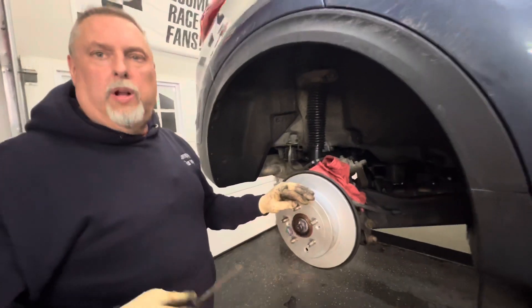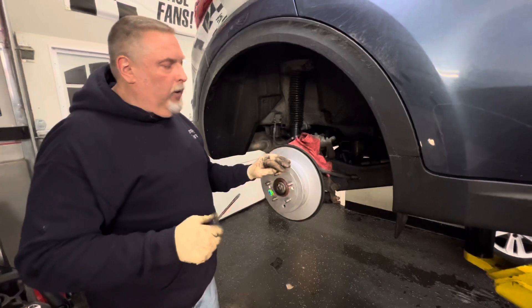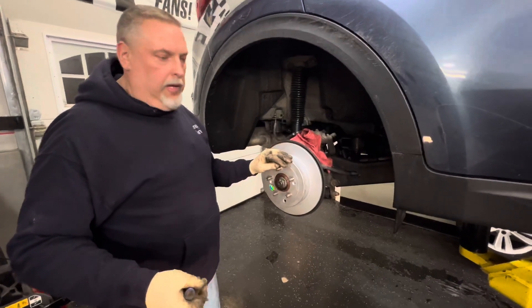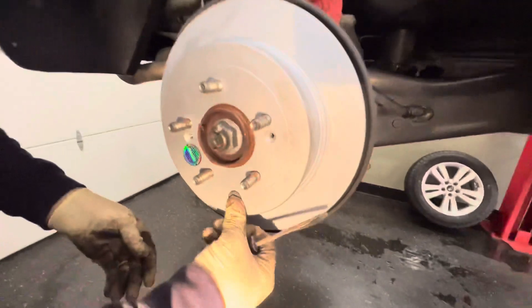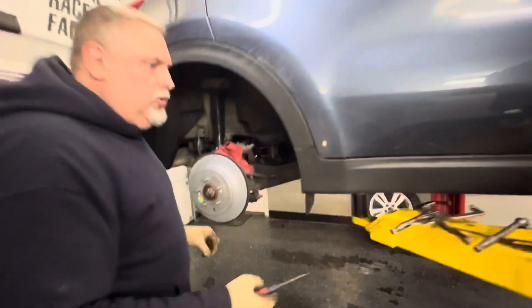This one's adjusted up properly. Take the little rubber plug and just pop it back in there. Put the two screws in. This is a fairly easy job — it's nice that the caliper piston doesn't have a screw-type piston; it just retracts and you can collapse it back gently.